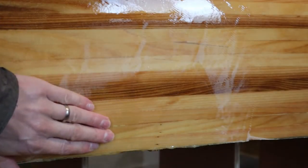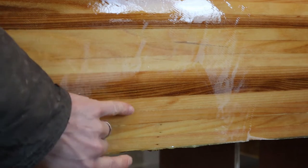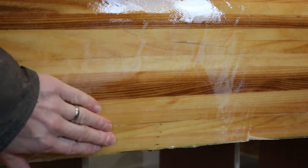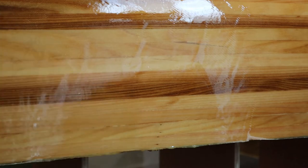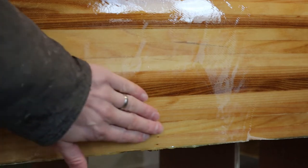There's still a very slight ridge in this one area where the fiberglass cloth was folded just for the first three planks or so, so I'm going to sand it down and rework it one more time with another layer of epoxy over the top. Then the final sanding should be completely smooth and there should be no hint that there was a fold layer.